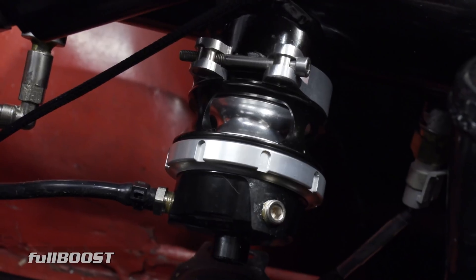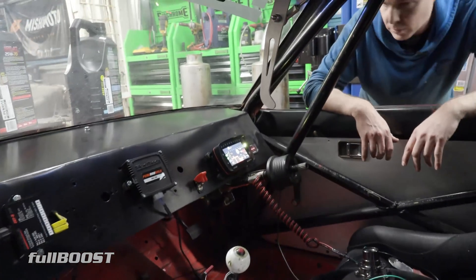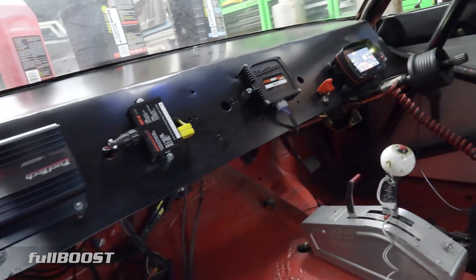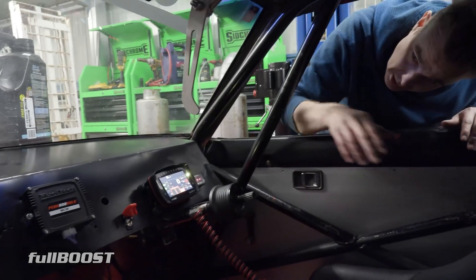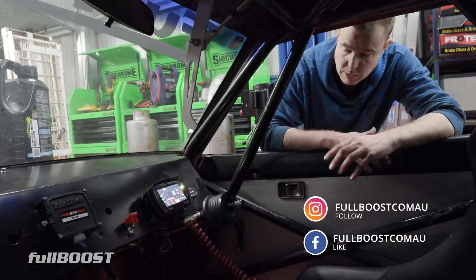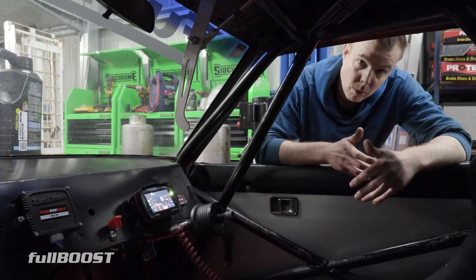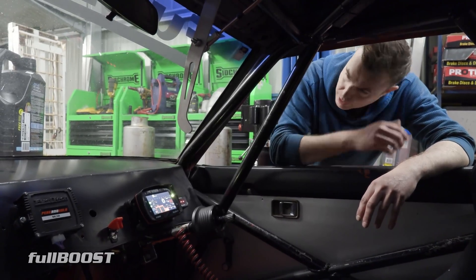The other changes in here are, as you can see, we've got the FT600 FuelTech ECU, the FT Wideband Nano, the Injector Boss, EGT, and the FT Spark 4. All these together are great, but even singly there's components. So the FT Spark is 600 millijoule spark energy, which is incredible. That's why with the water injection setup, you really need something with decent spark to ignite that stuff. And if we do go methanol in this car or a car we build in future, this is all future proof, so I won't have to upgrade this stuff again.